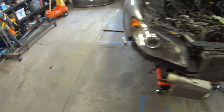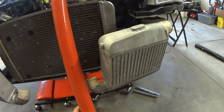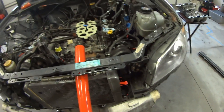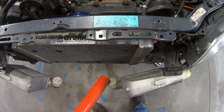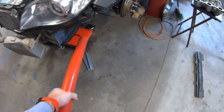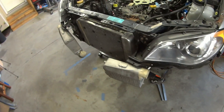Now I can show you the idea. This pipe is a little small, but imagine it as an intercooler pipe coming up from the intercooler and going through here to my intake. I'll have basically two of these coming through going to the throttle bodies, which should be right about here — just a 90-degree bend on each one, not too bad. From the turbo it routes this way, and all of it tucks behind the bumper. I've specifically lined it up to stay behind the bumper, so it's going to look pretty nice when it's all done.